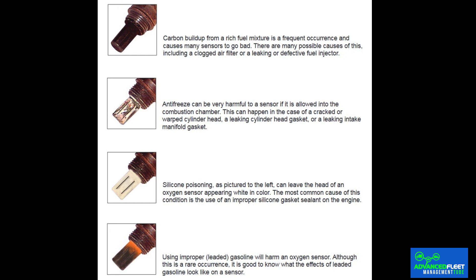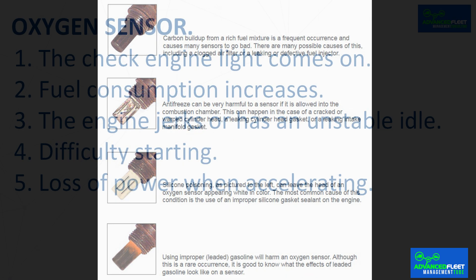Wear and tear is one of the most common causes of oxygen sensor failure. This component is exposed to high temperatures, unburned fuel residues, contaminated oil, and even coolant, which can deteriorate its performance. A dirty or damaged sensor sends erroneous signals to the control unit, which can cause combustion problems, jerking, and loss of power.